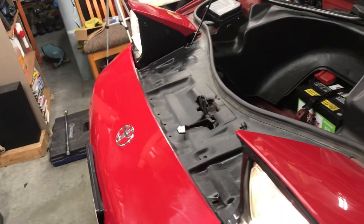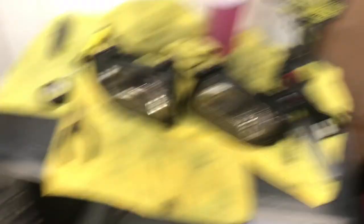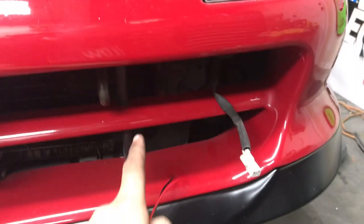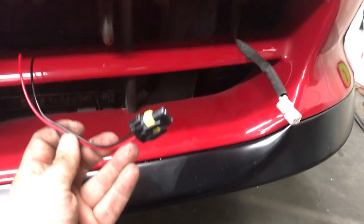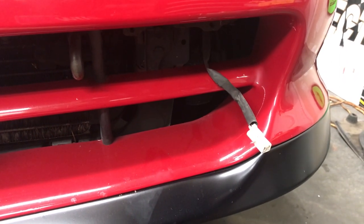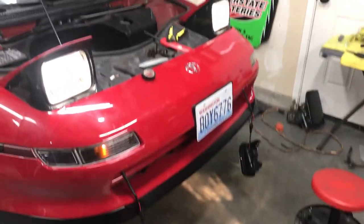I can't see anything in my messy garage, but I'll align them outside in the dark when the car is back down. Headlights are done — let's move on to the fog lights. Those are the fog lights we're installing; he went for a smoked look to match the markers and sides. This car doesn't have the cutout but it does have the wiring and brackets for the fogs. The plug is different so I'm going to splice this one in, trim the bumper here and here, plug them in and we're done.